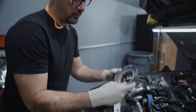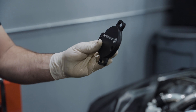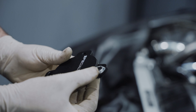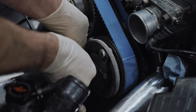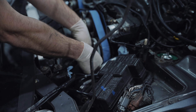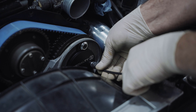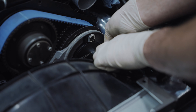Our original bracket minus the sensor goes back in. This is the plate for the VG — we're going to dress it up a little bit using some Z-spec hardware, these washers and bolts, to give it a bit of contrast with the logo. The last piece is the sensor. We thread the sensor in until it bottoms out against the rotor ring that we have installed. Once it's bottomed out, we turn it back half to three-quarters of a turn, then set our lock nut in place — that gives us the appropriate gap between the sensor and the rotor.